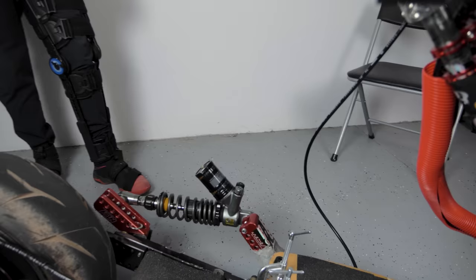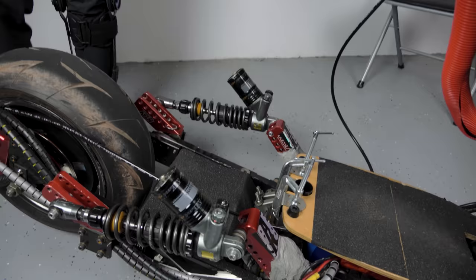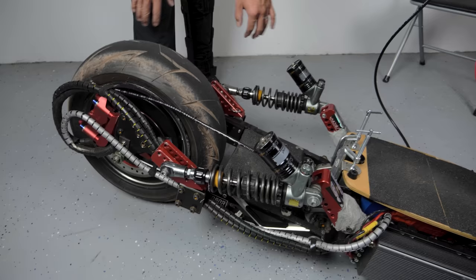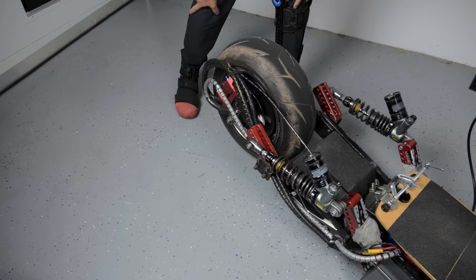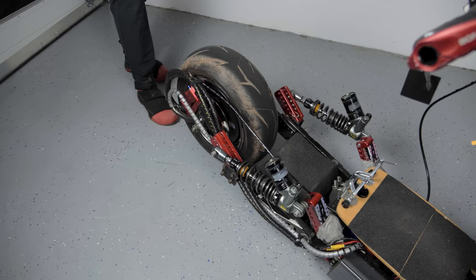So we talked about this rear fork here — you bought that separately for a motorcycle. This part is a motorcycle rear swing arm. This one I needed an adjustable one, so it gives you a few options to extend it out or bring it back in. This also gives you some adjustable mounts for the shock towers. Just having some flexibility made a big difference. Plus this manufacturer is totally different than this hub wheel, so I needed something where you can adjust — this all comes apart so you can get it real tight.